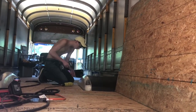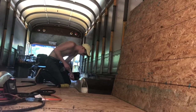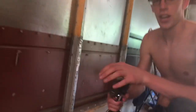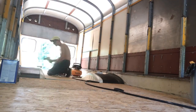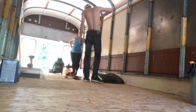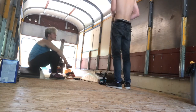The subflooring plywood came in tonight. With a drill using a longer bit, it could reach all the way through to the metal. It was important that we put the plywood in directly over the insulation — this saved us time and money. We ended up putting in three-inch wood screws to anchor the plywood so it wouldn't shift, anchoring it into the actual metal of the bus.